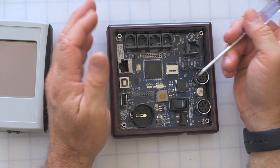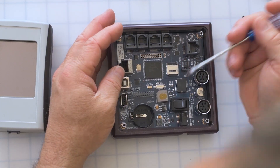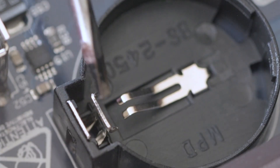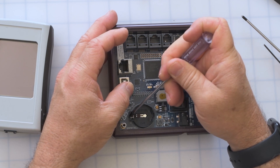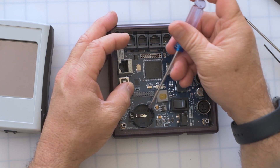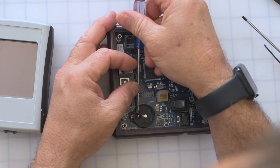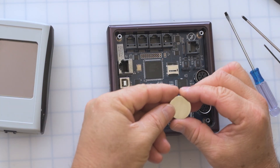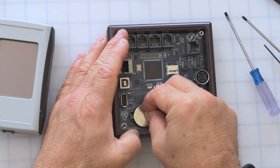One thing I like to do before putting in the new battery is to double-check the tension on the contacts. If the battery is not well tensioned and doesn't maintain that connection, you could have things like lost settings. So using a flathead, I just gently bend this side one in just a hair — be very very gentle, otherwise you might break it off — and just dip the screwdriver beneath the bottom one just a little bit up. Make sure to get both tines. Now take the new battery, plus side on top, and just slide that in until it pops into place.